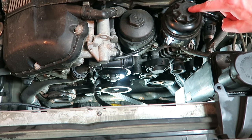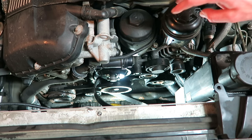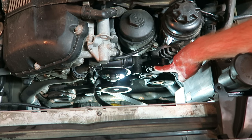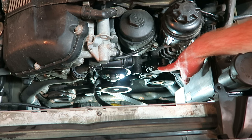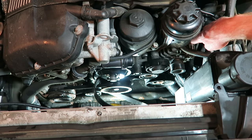We're going to remove our power steering reservoir. There are two bolts attached to the oil filter housing. We'll also pry off this dust cap and remove the bolt, because this bolt is securing the top part of the alternator to the oil filter housing.